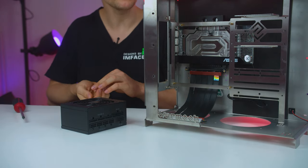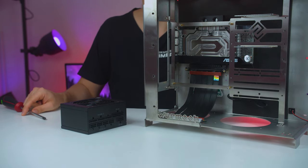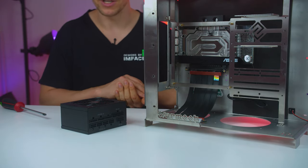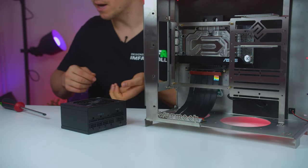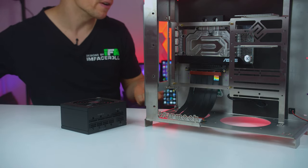But the good thing is, the fans I'm going to install last. So I can just have a fan to the side and fill the reservoir from the top and then just do the screws up for the fan and we're all done. Draining the system though is gonna be a different issue, but maybe I could put like a T-join down the bottom on the radiator port. So we'll see what happens there and we'll definitely figure it out.